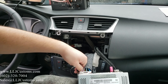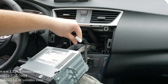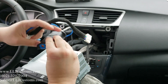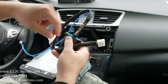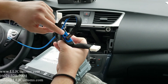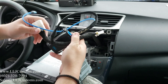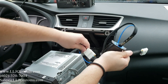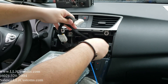What we're focusing on right now is this little harness in the back. Once you have that out, grab our T-harness. It comes in a box with your pack unit, remote turn-on wire, the T-harness itself, and the built-in gain. This is the LP72, which does not have the built-in gain remote. If you want the built-in gain remote, you'll want the LP72R or the LC2i.